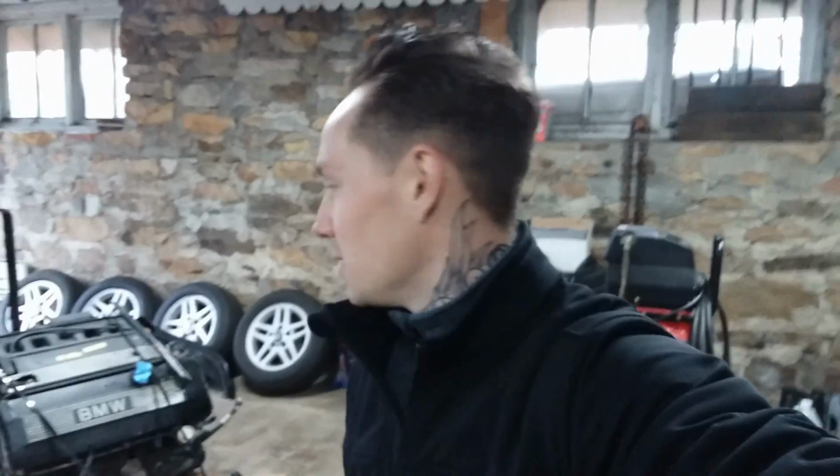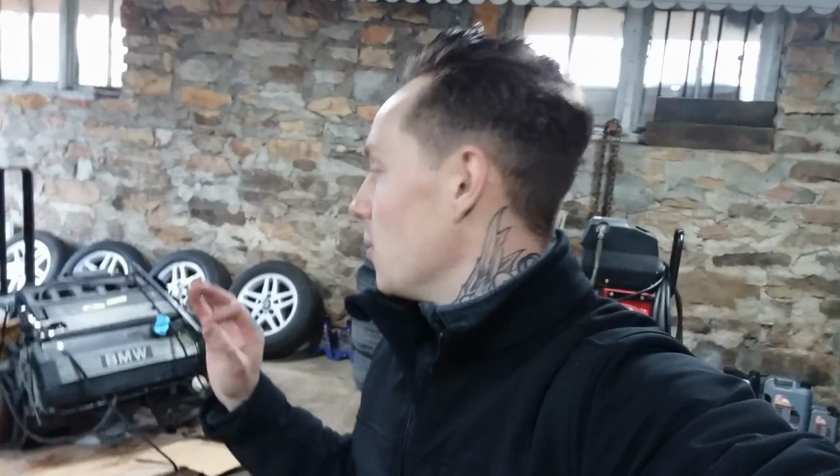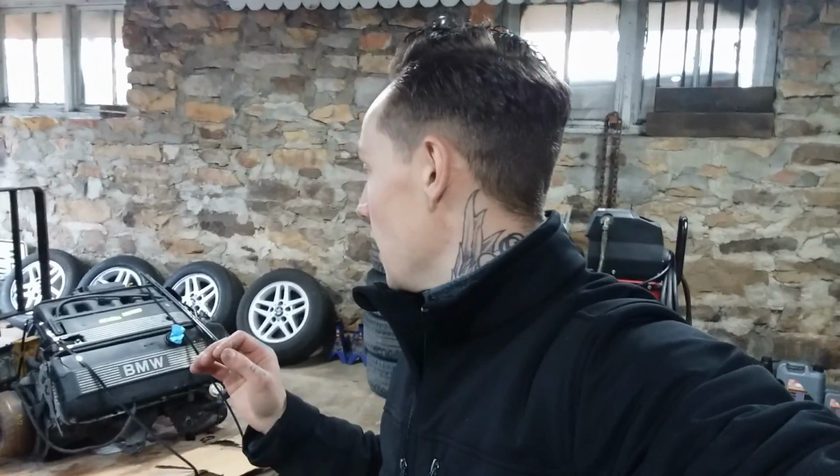You're probably wondering, Tyler, come on, man. That engine, it's nothing crazy fast, nothing powerful. It's not about that. It's about the certain things this engine has. We have a 2.8 forged crankshaft, which has great harmonics at the higher rev range, more safe than a B30. We have stronger oil control rings on the pistons, less oil consumption. And my tuner and I also prefer the stroke of this engine and certain tolerances within the engine over the B30. They're easily modifiable, just like any E46 platform.